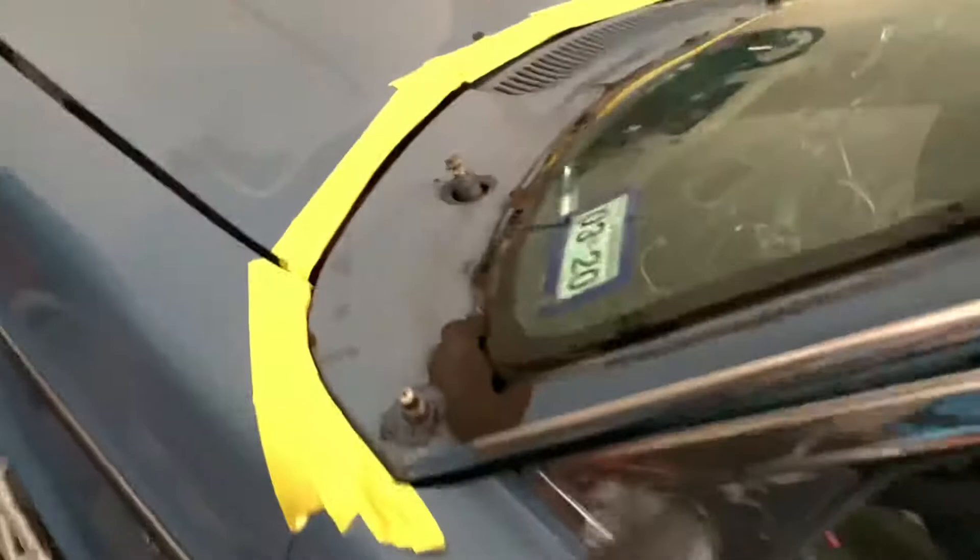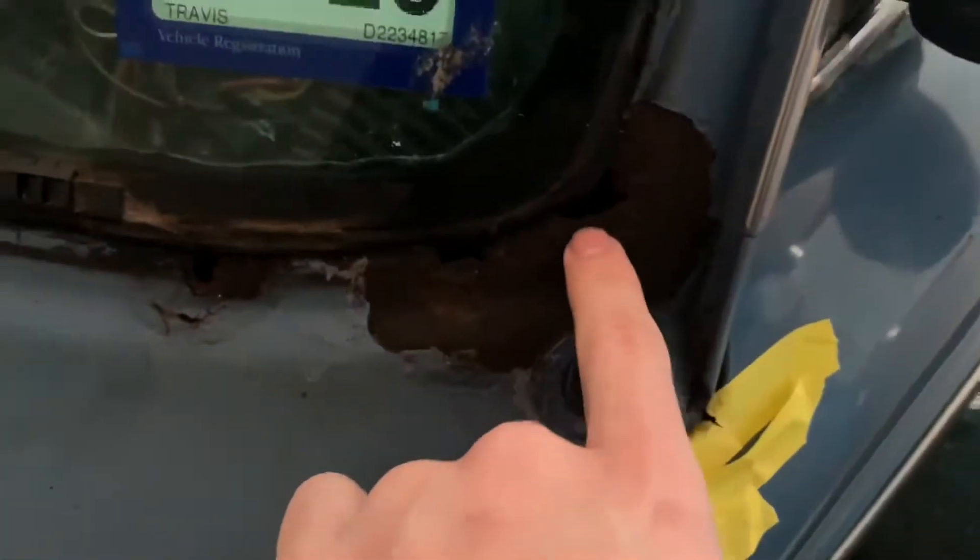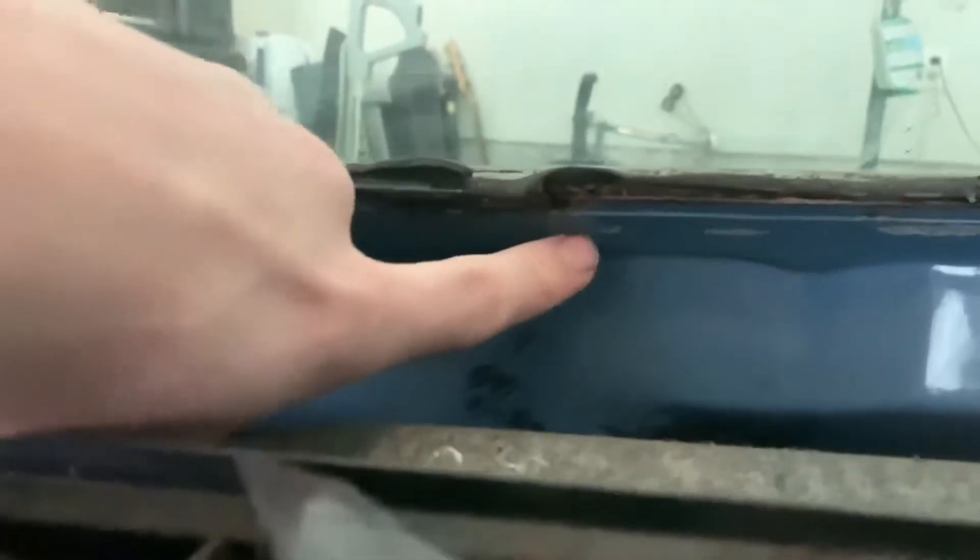Sorry about my throat. After I took the dash out, I realized that a lot of this damage looks like it's going to be exterior. The windshield does need to come out in order for me to fill these holes, but they're fillable. Looking along the interior, I'm not seeing a whole lot of corrosion making its way in here - maybe a little bit. Right there looks like where one of the main leaks might be coming from.